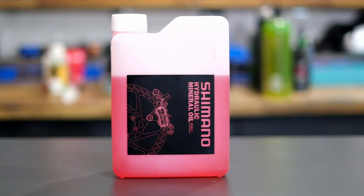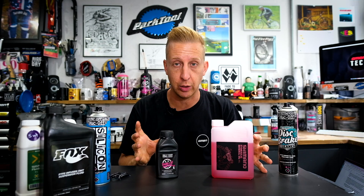From time to time you're going to need to bleed the brakes on your bike if you've got hydraulic disc brakes, in which case you'll need the relevant oil. There are two main types: DOT oil and mineral oil, and you must observe the correct type for your brakes — that is paramount. DOT stands for Department of Transportation; on mountain bikes you get DOT 4 and DOT 5.1. Then there's mineral oil, of which there are different branded versions — they are all slightly different, so you really should stick to the recommended one for your brakes: Shimano oil for Shimano brakes, Magura oil for Magura brakes, and so on. Mineral oils are non-regulated and have very different formulas to DOT oils, which are regulated by the Department of Transportation to certify they work in specific conditions.